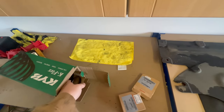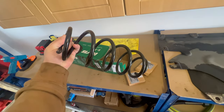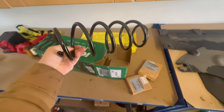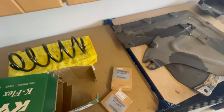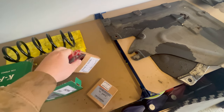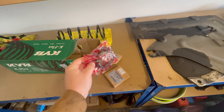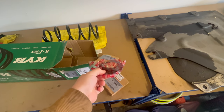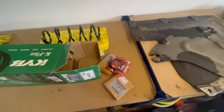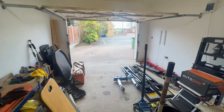Today I'm going to change the rear spring on my Toyota IQ because it failed the MOT — the spring was either broken or cracked. Also, since I'm already there, I'm going to replace the new spring caps as well, because the car is now around 12-13 years old and the rubber gets old and becomes more like plastic. Since they are quite cheap, I'm going to change them anyway.